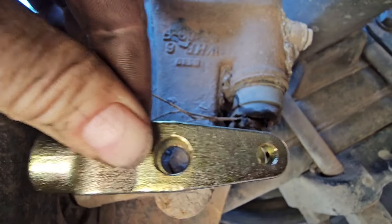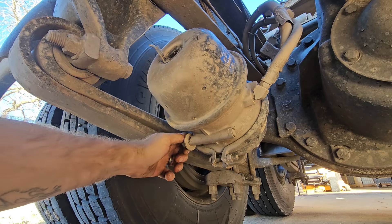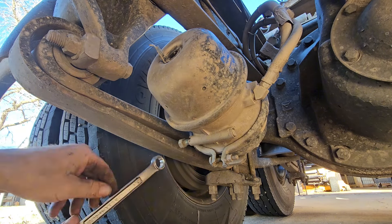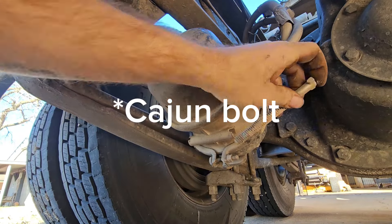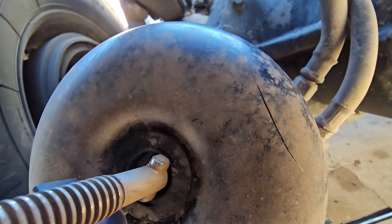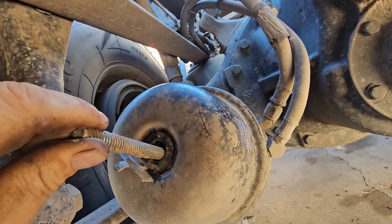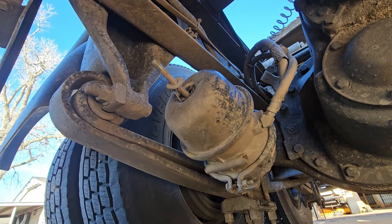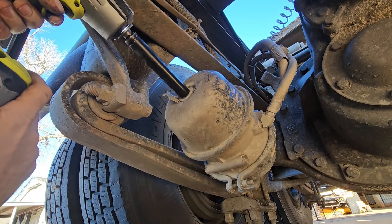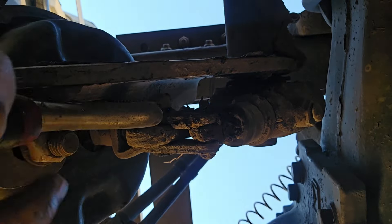I went ahead and caged the chamber while I was working on it so the rod would be fully retracted. That way I didn't have to start up the truck and release the brakes — much easier and a lot safer. You just pull out the caging bolt, which is what you're seeing right here, and you insert it into this slot. You turn it to the right 90 degrees and it locks in place — you can pull on it and it won't come out. Once you have it locked in, put the washer over it and screw the nut onto it. I have a special caging socket that I use to tighten it down.